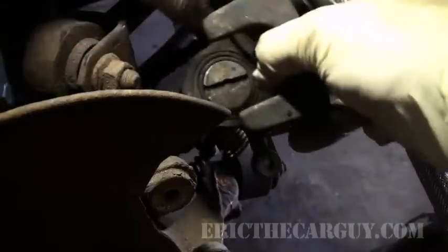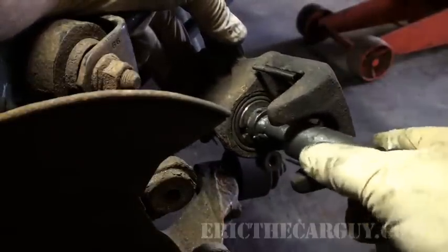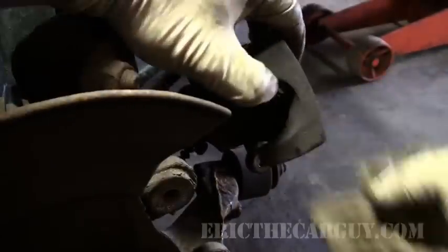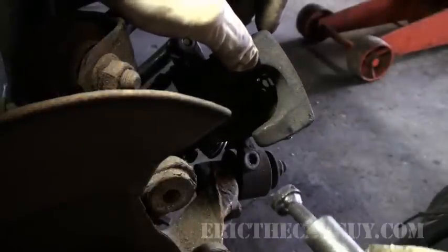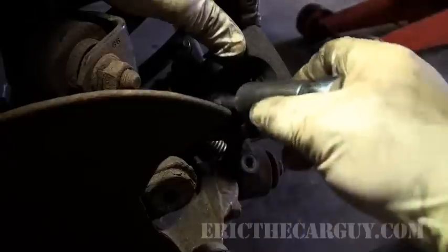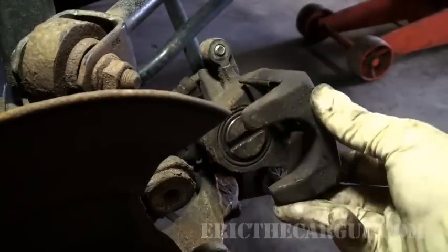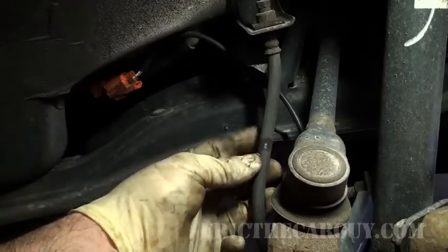Tighten down the bleeder — important. You will find that these will want to fight you. You want to make sure that this slot is directly straight up and down. Some of these are like plus-sign things, but you want to line it up right with the middle of the caliper — get it to 12 o'clock. Don't ever try to turn it in the opposite direction — turn it clockwise only. There are different manufacturers that have different ways of doing this, but if you're working on a Honda, this is pretty much the rear brake setup. Make sure that piston is at 12 o'clock. You can remove your vice grips now — no real harm was done to the hose.